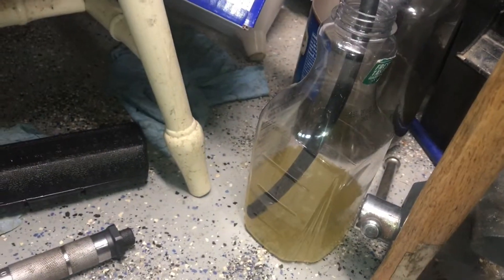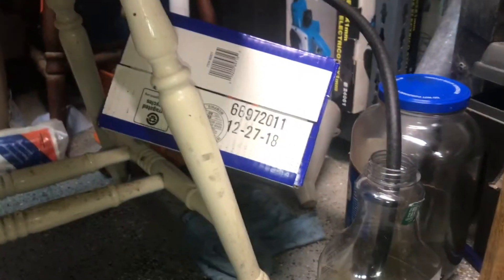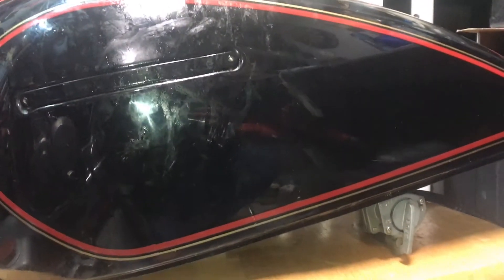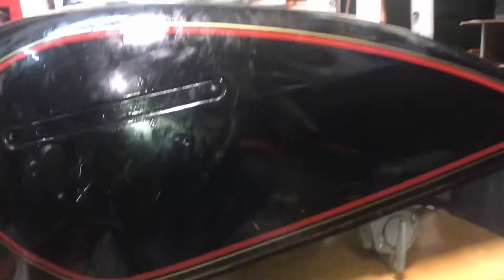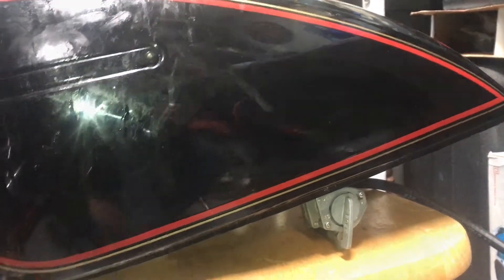We're pouring now, draining it. Maybe I should rinse the tank with alcohol or put motor oil in it. I'm so pleased with the results from using Evapo-Rust — there is basically no rust inside this tank anymore. Any remaining rust is not even surface rust, more just oxidation and brown stuff, which doesn't soak into the fuel like particles do. I'm very satisfied with this.